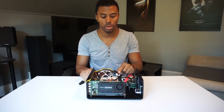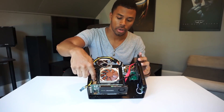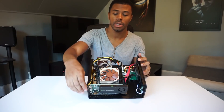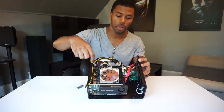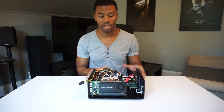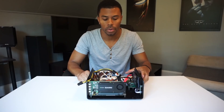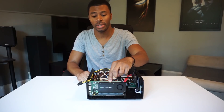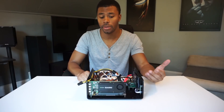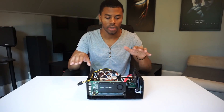One last thing: the power cable from the Pico PSU used to go over the CPU cooler, which decreases airflow. So instead, I got an extender piece and routed it from the side all the way with these clips, then out. It's a much cleaner look, doesn't block the exhaust at all, and keeps everything cleaner and cooler. I'm getting about 43 degrees idle, which is not bad for a system this small. The Quadro card puts out significantly more heat than the old K620, since it's more powerful with more RAM. So some finagling was needed.